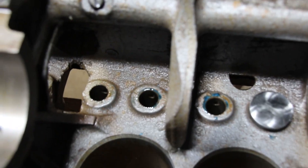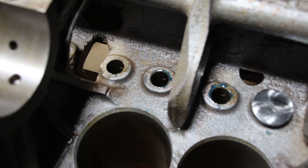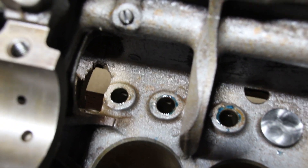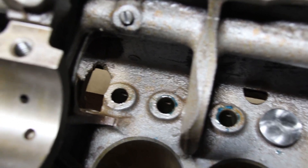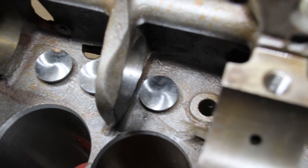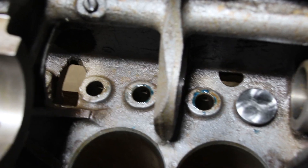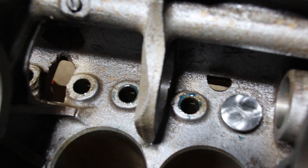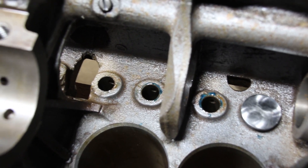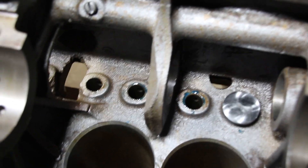I got the back one in, but the tappets don't fit in the factory hole. This tappet bore right here is exactly 0.625 — five-eighths of an inch. Tappets are usually 0.623 or 0.623 and a half. For some reason, the tappets that Ron sent are 0.625 — it's size for size — so we have to enlarge those holes a little bit.